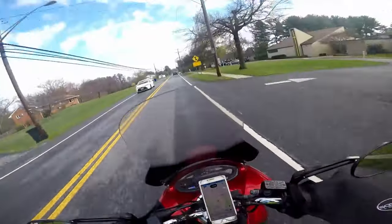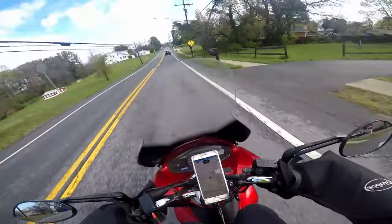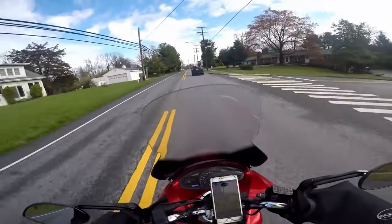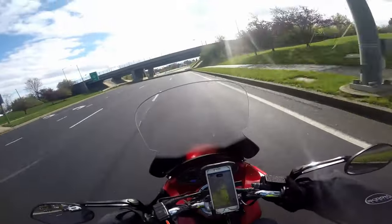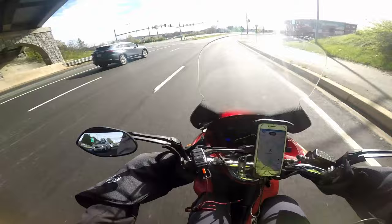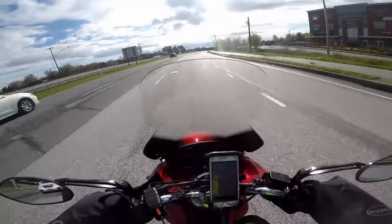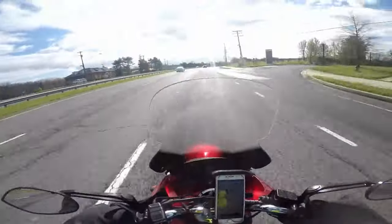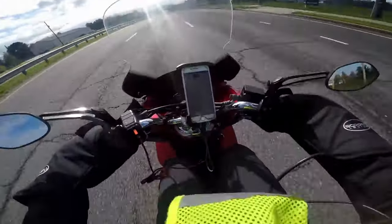And I have done about 74 miles so far on the tank on these weights. And it is slower acceleration. Acceleration is still good with the 19 gram weights. But what I enjoy about this bike is how smooth and fast it is off the line. And now when I go up to a red light where I would have beat a bunch of cars, it's just not as fast, even like the acceleration. It's as if it brought the revs down, but it's completely doable.